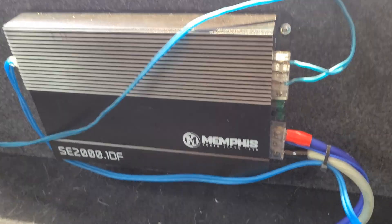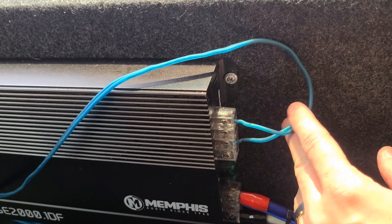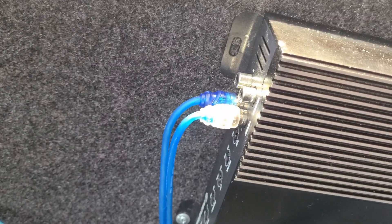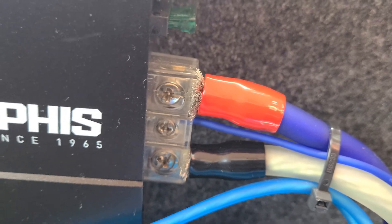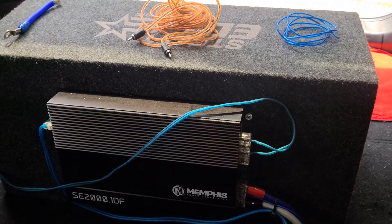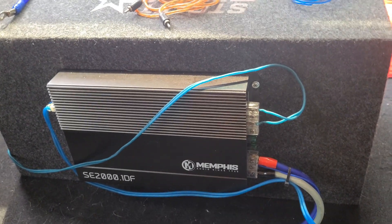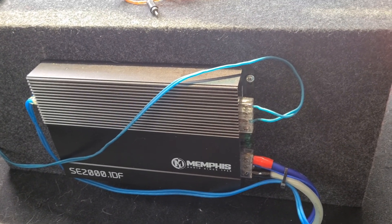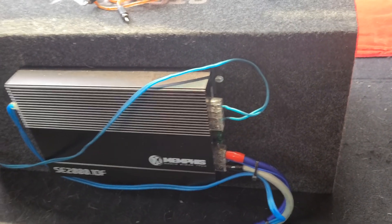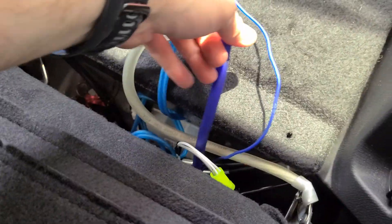Walking over the inputs on this amp: you'll see the ground wire, the power, the speaker wires going to the subwoofers, two RCA cables, and the remote turn-on wire. This was professionally installed, but check out the links in the description — I'll do a video rating the quality of the installation and covering things to watch out for. Now we'll go under the hood to get a general idea of how we're going to run everything.